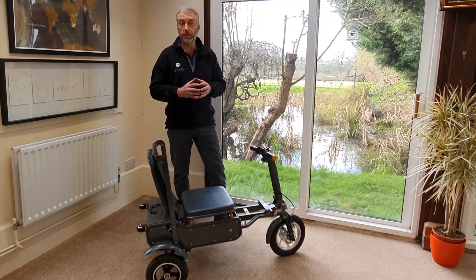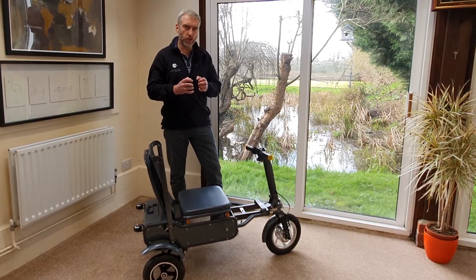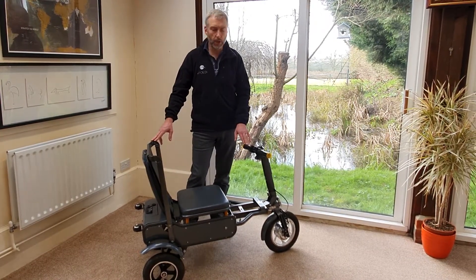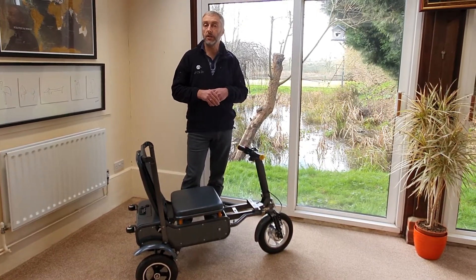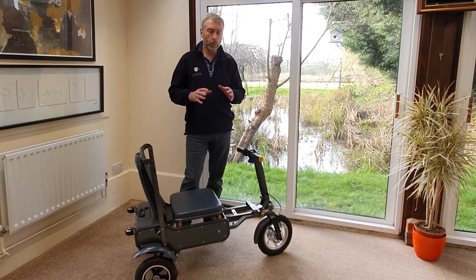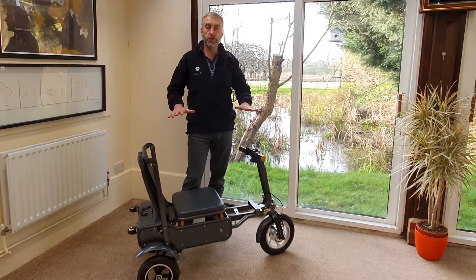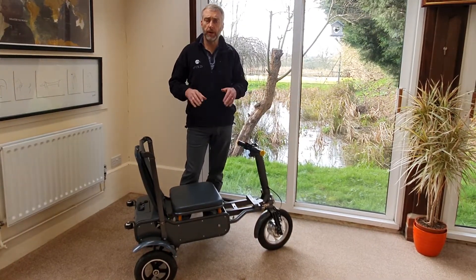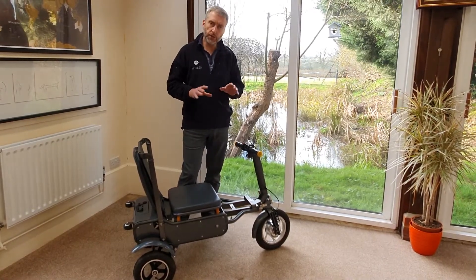If you are often out in the rain or go over muddy areas, or areas where grip is challenging — because with the nice high ground clearance these are very good off-road on grass — but if it's damp, personally I would run the tyres with slightly less pressure, maybe 22–25 psi. That allows the tyres to squash slightly more, giving more surface area on the ground and more grip. Anywhere between about 25 and 30 is absolutely perfect.